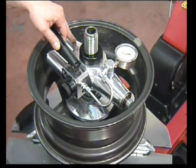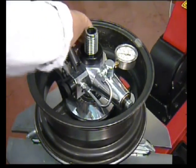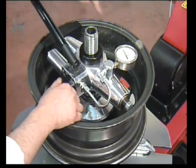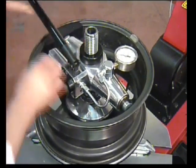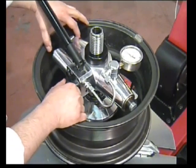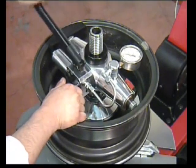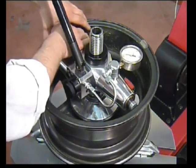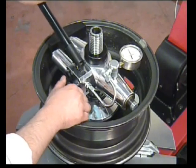Working our way around the arc — the part of the rim that has been damaged — we take out the spacer bar at the back so that we can rotate the rim to see how we're doing. We still need quite a bit of work on this rim, so the spacer bar is replaced and the wheel is tightened at the front. Now we're going up to roughly 200 bar. Easy Round is a great safety device because if there would be a micro fracture at this point, there would be a loud burst, a loud pop of the rim — the fissure would be widened and the rim has to be scrapped and cannot be repaired. So Easy Round saves lives.